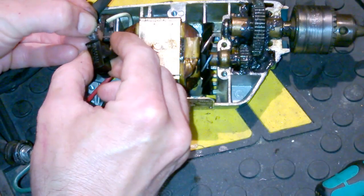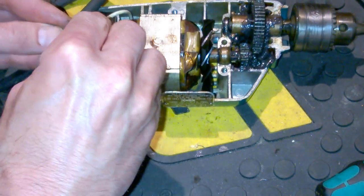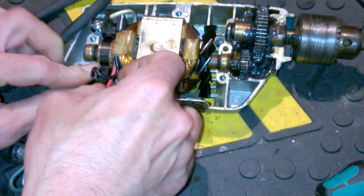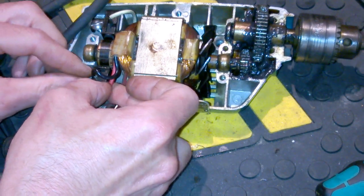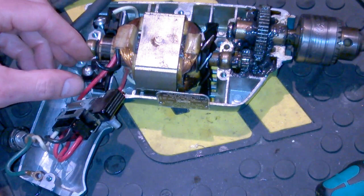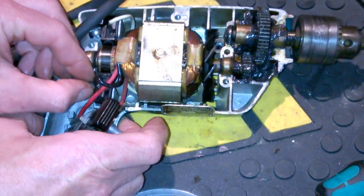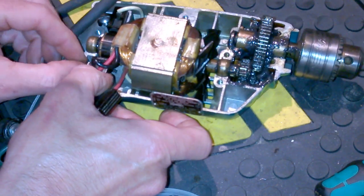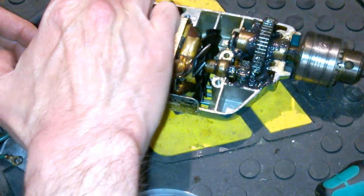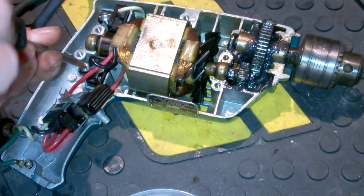Notice I've got the hook on the bottom of the brush and the spring below. We're going to push it through — there's a slot for the wiring to go through. There we go — got it in. There's a slot in the back where the black wire goes. The wire hooks onto the spring, the brush is at the bottom, and the spring below that provides pressure, pressing the brush against the rotor. Now all we have to do is take that screw and screw the plastic casing for the brush into the body, which holds it in place. I already did the top brush — white wire at the top, black wire at the bottom for this one. This works basically the same on all drills or any brushed power tool.